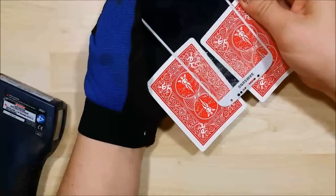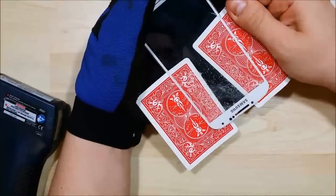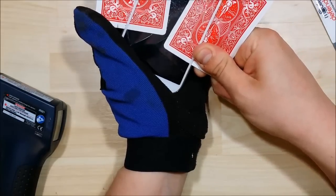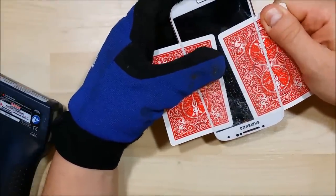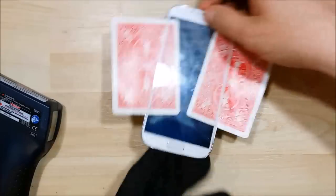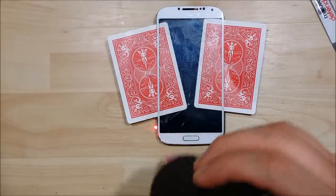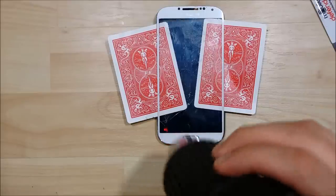Try to get the card to a pretty even spot before moving on. You may get it kind of sticking on the sides of the phone where that rubberized adhesive is. If you pull it back in a sawing motion as you move down the phone when it gets stuck, that'll go ahead and unstick it from the frame. If it gets stuck, pull it out, push it down a little bit farther and get underneath that shattered portion of the glass. Now we're starting to get a little resistance on the glue, so we're going to go ahead and reheat the phone again. Try not to get too far above 180 degrees.